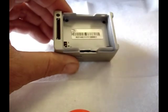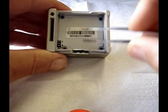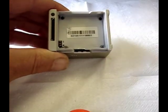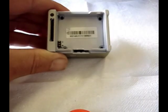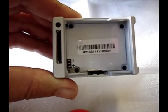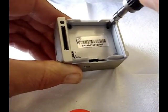I've already taken it apart and done everything I'm showing you. One thing I didn't do when taking this apart: this whole entire outer section is a sticker, so you're going to get a pair of tweezers and pry underneath it and peel that sticker off. Now you have four screws — there's one in each corner, and the two on one side are different than the two on the other side, so keep those separated.